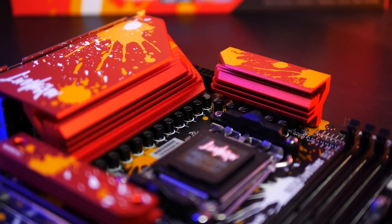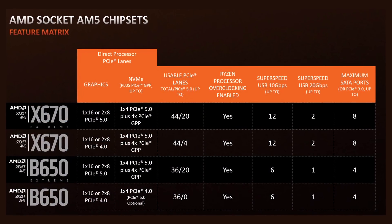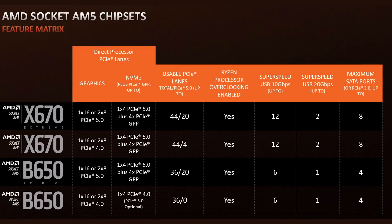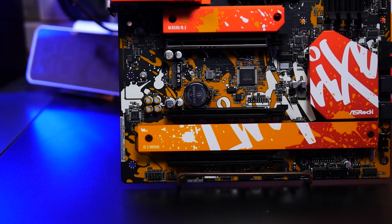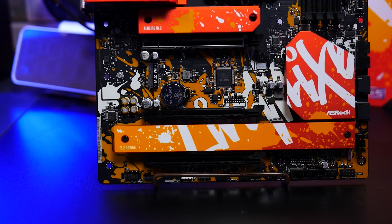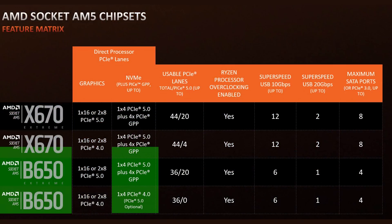You may be thinking about the differences between B650, B650E, X670, and X670E. Should you spend the extra money and go for an X670E over a B650? This ties in with the VRM and CPU tuning we just did, as well as memory tuning. As a B650 model, it has the only option for the Gen 5 X4 slot on the SSD. The other PCIe lanes — via the three M.2 slots or the three PCIe X16 slots (two being X4 Gen 4 and the top one being a true X16 Gen 4) — don't utilize Gen 5 lanes now or in the future. The option exists only if the motherboard manufacturer has decided to put those four lanes via the M.2 slot.